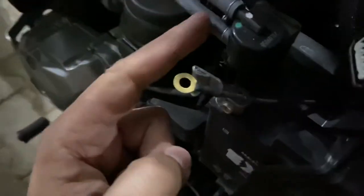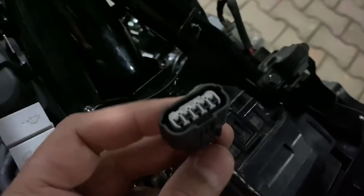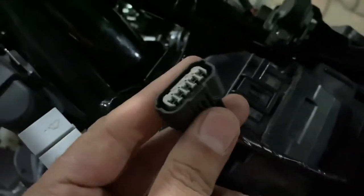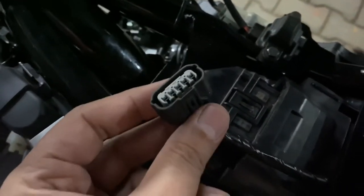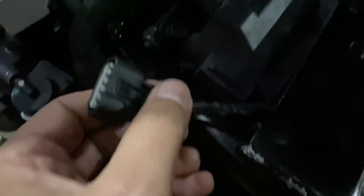The tank has been removed for easy accessibility. This is the fuel pump; the fuel lines and breathers are here — totally four of them: one, two, three, and four. There is the pump electric current line, a pump control line, and the average and level gauge lines. These are the signal connectors here, so no need to touch the signals.